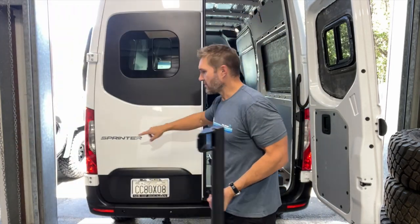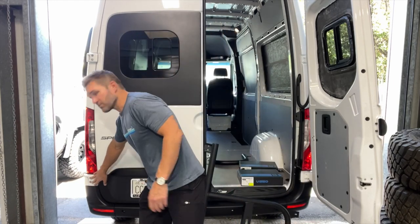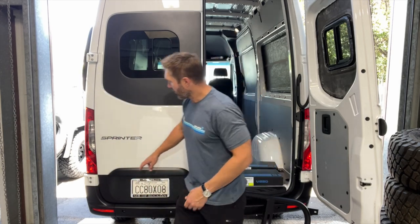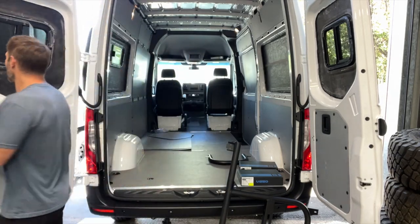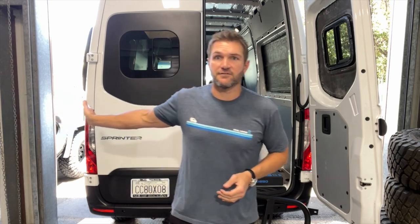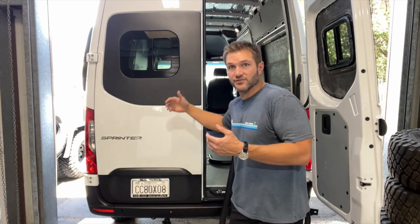What we're going to be doing is mounting to the hinges. One of the first things you want to do is make sure you have 180 hinges. A 180 hinge has two holes in it, top and bottom — the 270 does not. A 180 will open 180 degrees. If your doors open all the way and fold against the side of the vehicle, that's a 270 hinge and you'll need to swap it for a 180. We sell them on our website. The other reason we want 180 hinges is it stops the gear from hitting the side of the vehicle — especially once you get a tire on it.